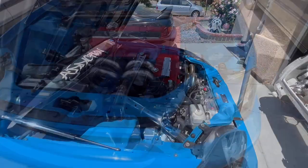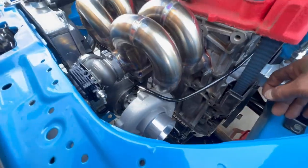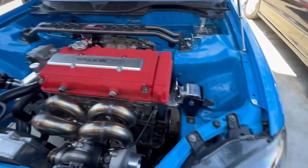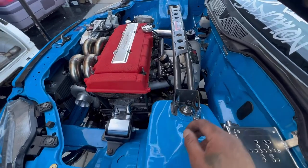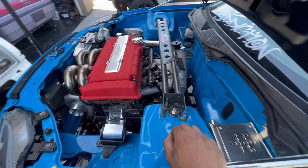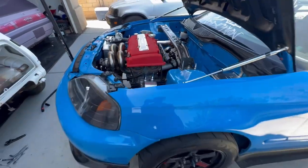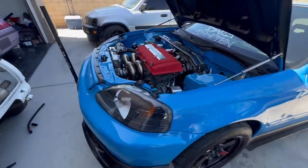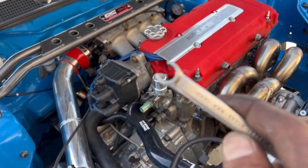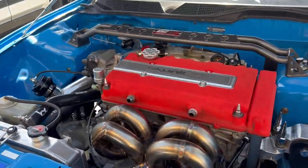New day — wrapping this up. Got the oil lines made, drain on, feed on, clamps on. I think we're ready to rock. Going to try to start it before I swap the injectors out, just to make sure everything's good and there are no leaks. After that we'll continue with the extra work: swapping the valve cover, swapping the injectors, and getting a tune made for the 1000cc injectors. Got the Speed Factory hardware on — had to use a custom wrench because with ram horns you can't get in there normally. Filled the oil, swapped the valve cover, ready to go.